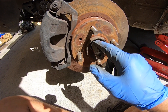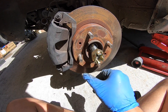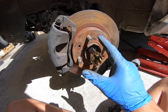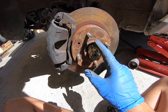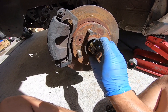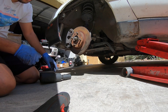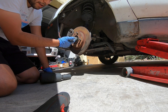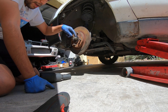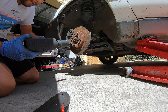I greased the axle also, so there's plenty of grease in there. I believe you put a little grease on the axle nut — but I'm not fully sure it's needed, so I'm just going to tighten this up. This axle has a lot of thread. You'll need a 32-millimeter socket. Usually this bolt lines up where you can put the cotter pin through the holes, but these are way off, so I'll still put it on just to play it safe in case the axle nut ever backs up. Hit it with the impact, give it a couple good ones, and call it good.